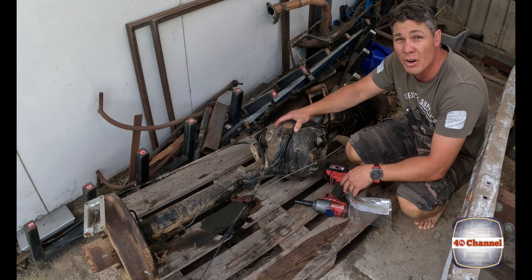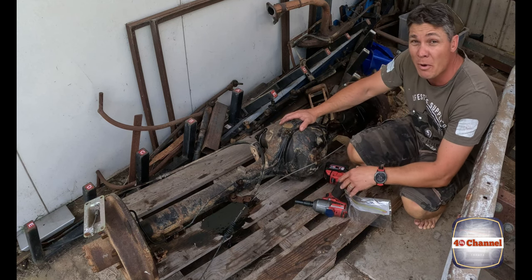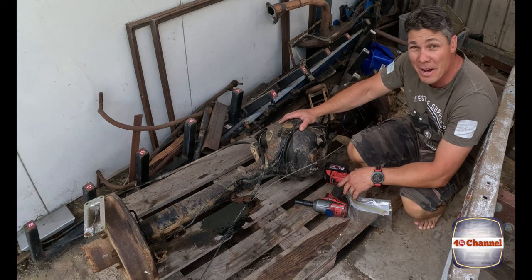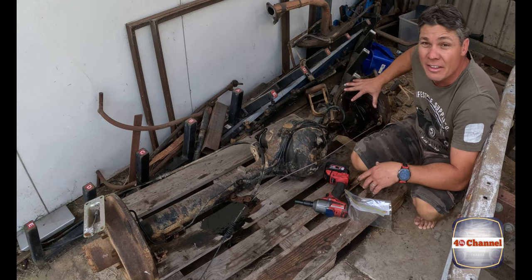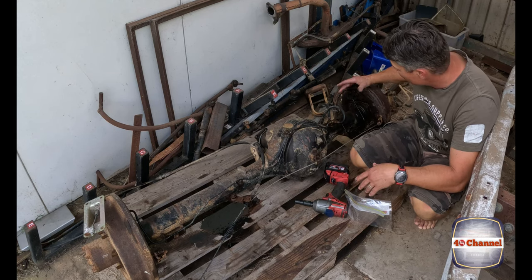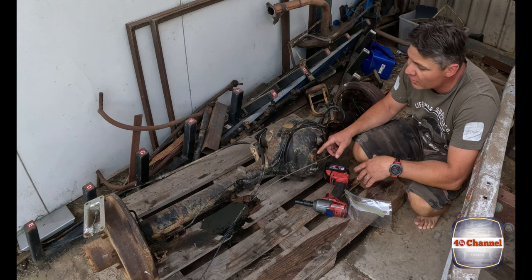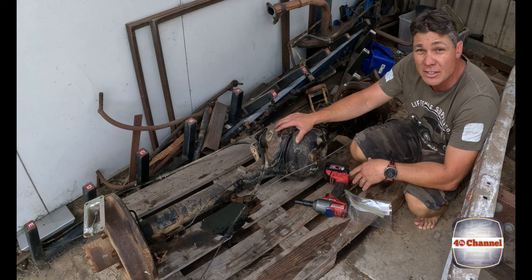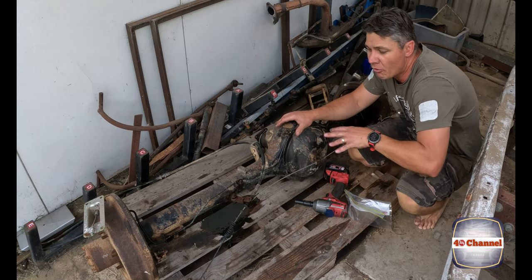What we have here is the entire rear axle of a 60 series Land Cruiser. I need most of the components off this to swap over onto the 45 troopie so we're going to have the handbrake rear brakes and a much better braking system on the rear end. All we need is the two end pieces - these have four bolts and this will not work on an earlier model because they've got six bolts. Under these four bolts we'll undo all the components to get all the bracketry, then transfer everything over onto the troopie's rear axle.